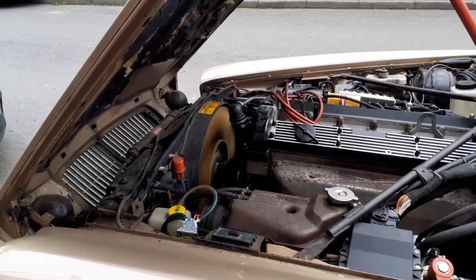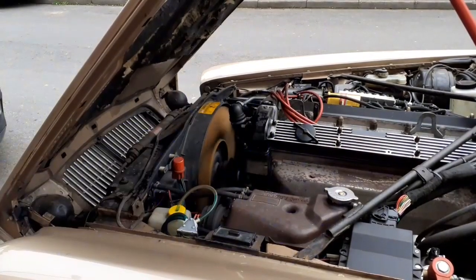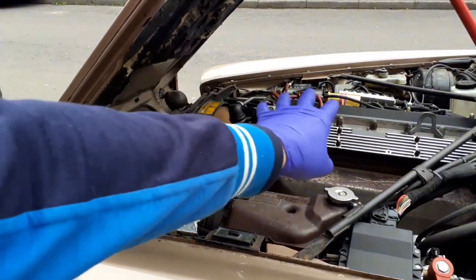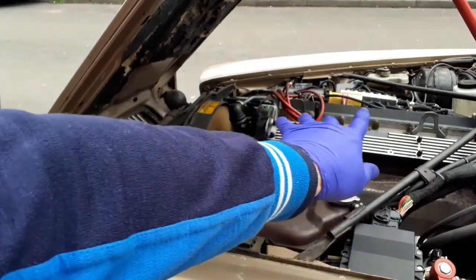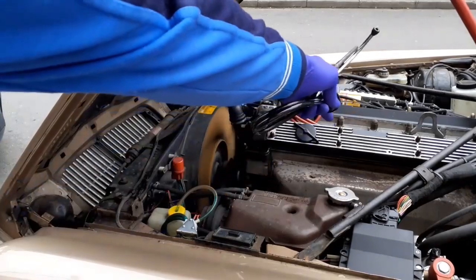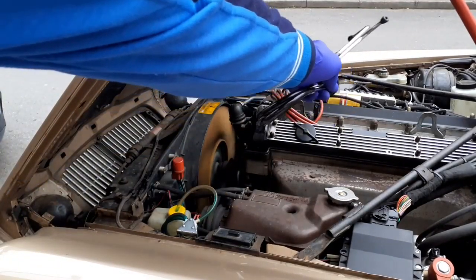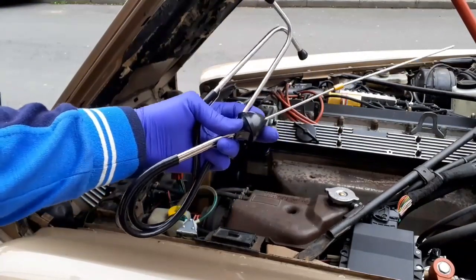If you saw the films about 6 months ago, in November, I had all of the injectors out, and I was opening and closing them with a direct short to a battery, and they were going tick tick tick, which is what you want to hear. But you do get quite a ticking, which can be mistaken for cam noise or tappet noise, but it isn't. It's the injectors. And this engine has also got LPG injection. Now that's actually quite noisy too. That ticks quite furiously, and I can hear it from here, and if I listen to it through the stethoscope, it's extremely loud.